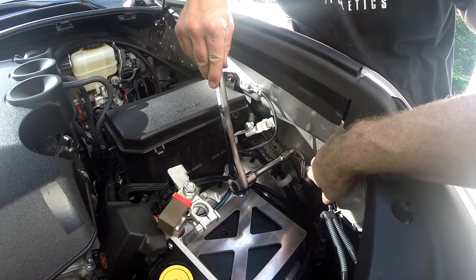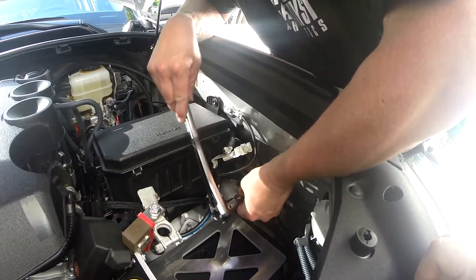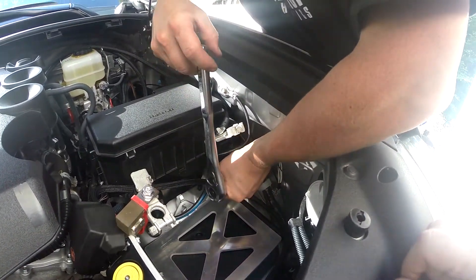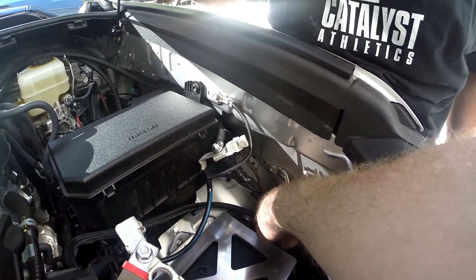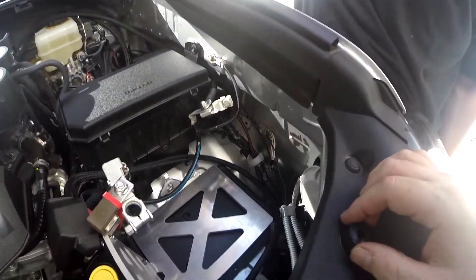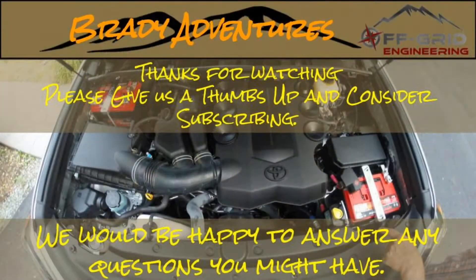We're attaching the ground that comes with the switch leads to the ground right behind the battery box — it's a perfect position. The leads running from the MLACR to the switch inside the cab have also been tucked inside the brackets along the way. A few more zip ties to snug everything up, and we're ready to drop the battery in. If you liked this video, please give us a thumbs up, consider subscribing, and feel free to leave any comments or questions.